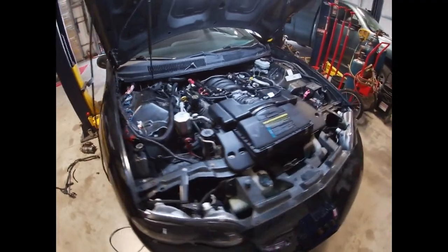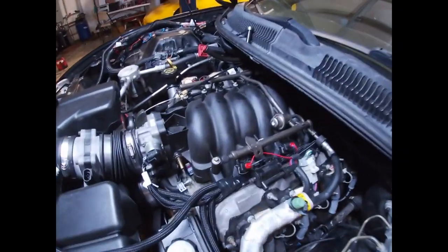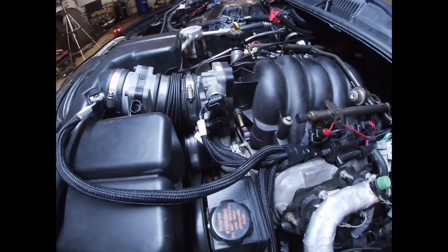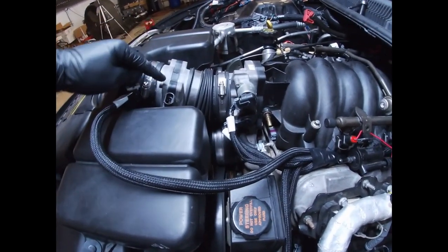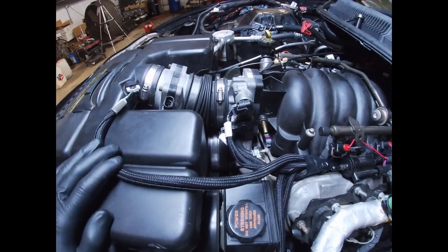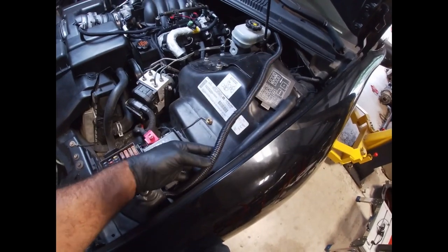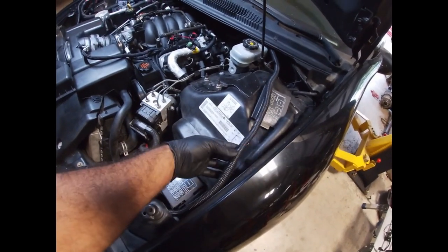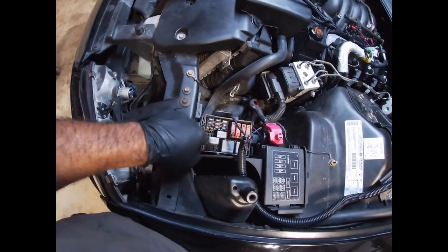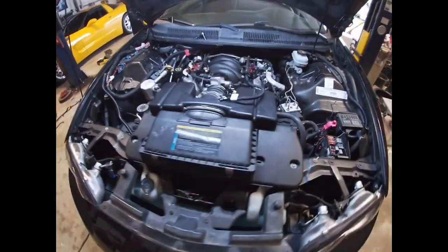Back up top — got most of this secured and the injector harness is in. Down here you can see the extra two-bar MAP wire tucked under there to keep it out of the way. Note that the Terminator does not use the mass airflow sensor, so we'll need some sort of coupler over there, but we'll leave it for now and it'll run fine. I went ahead and ran the wire for fuel pump power — there's also a tach signal wire in this loom — and tested that out. Power goes back to the fuel pump and it works fine.